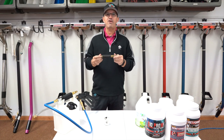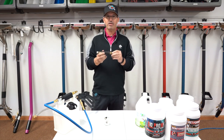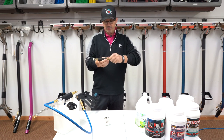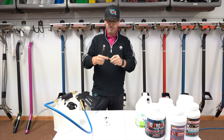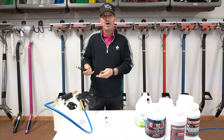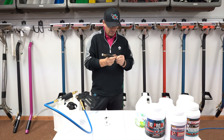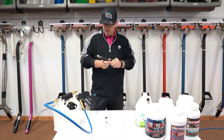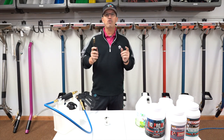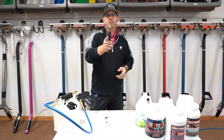Once a month — and this is probably the biggest area of concern I've seen with cleaners coming into my shop — they do not clean the filter that's inside their handle. There's a cone-shaped filter in here. Just screw it apart and you'll notice this filter which catches all your sediment and debris. This affects your PSI, it won't draw properly, and you're not going to get the proper amount of pre-spray down or ideal results. If you do all of these things, you're going to notice it performs much more efficiently and you get greater results.